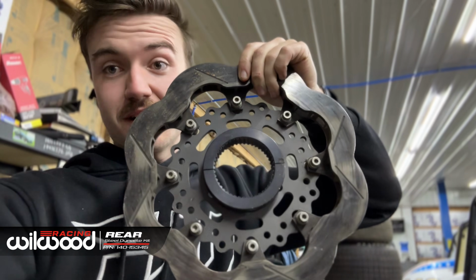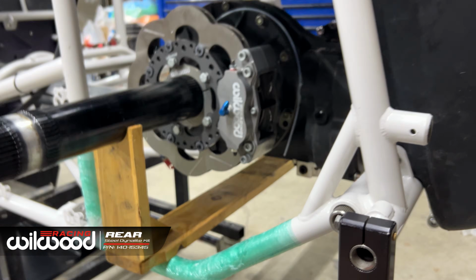And these came off the car and we never have them loose, so my theory is red Loctite. Just check them every now and then maybe. It is recommended you do tie wire the two of the bolts together around the hub.